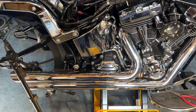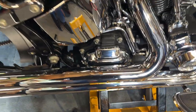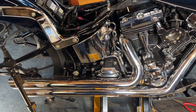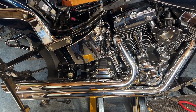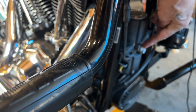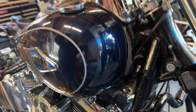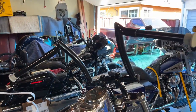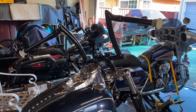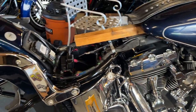I got the oil tank and all that back in there and completed. I need to take this guy off here so I can remove the clutch cable cover to put the new clutch cable in. I'm looking for the brake line that comes from the ABS all the way up to the bars. I need a new one of those and I've been having trouble finding one. I've also ordered the air filter.